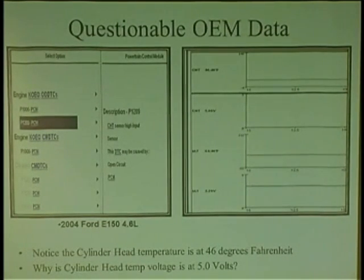So if you have a code that says coolant sensor high input, look, if it sees 5 volts, that's high. That's an open circuit. Either it lost the ground or it's broken. Something's broken. So if you put your voltmeter on that wire, the reference voltage will be 5 volts. So you go, well, it's either the resistor's not there anymore, or the ground is bad, or the connector's open. You already know about the 5 volts. It's all about that 5 volts.